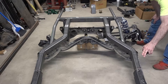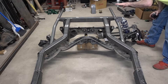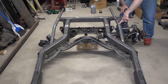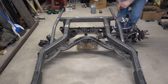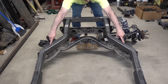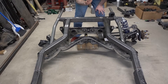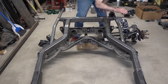So whatever you do, if you're going to follow this rail straight up and then come straight back, you're going to come up 24 degrees and then flatten back off — go back 24 degrees to make it level up top. What I would have done differently is I would not have taken these rails and brought them in so far. I would have made these turnouts probably closer to where these tubes are and come right over top of the rear upper control arm pickup point. That's why I put these tubes on here so I didn't have a big long shock mount.